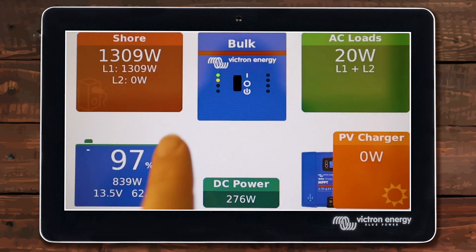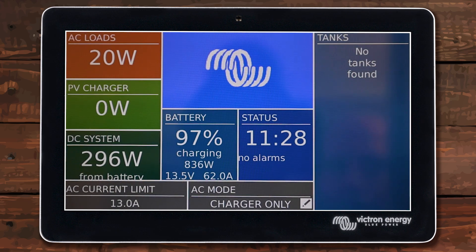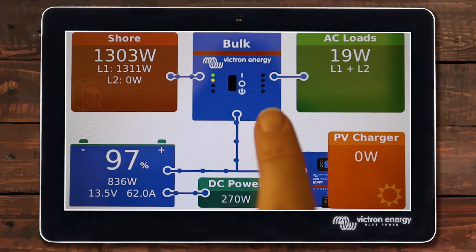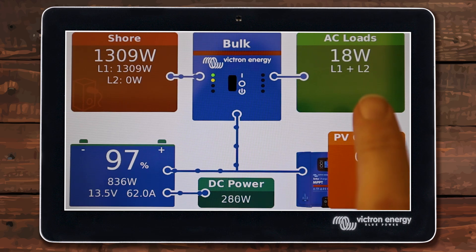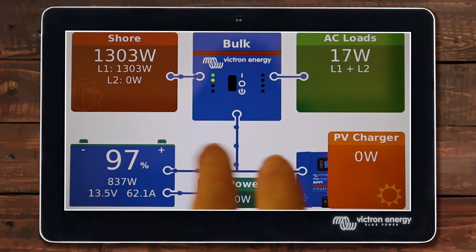With charger only mode, when you lose incoming power you would lose any 110 volt power, but when you come back to the RV it would still be pretty full on power. You could then turn the inverter to on and choose what you want to run off your battery bank. When the inverter is in inverting mode it is pulling power directly from the battery bank, and although solar tries to fill the battery it might not always keep up, especially running an air conditioner and a residential fridge.